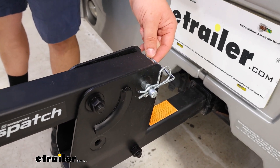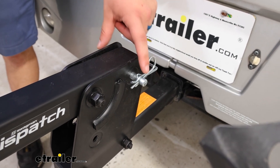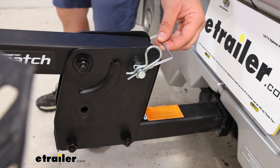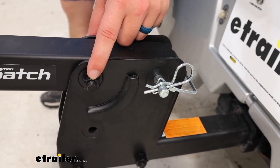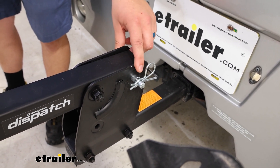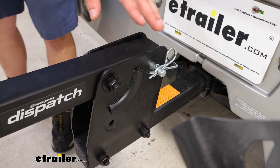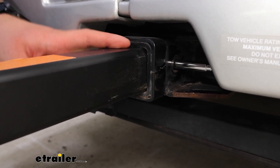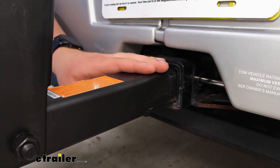This rack does have the ability to remove this pin and clip and fold it upright for storage. But when used on a motorhome, Swagman wants you to replace this pin and clip with an included nut and bolt — this is how it's going to come out of the box, so that's what it looks like so you know what to look for, and the replaced hardware would look much like this nut and bolt right here. Because of that, you're likely not going to be folding it up and down very frequently on your motorhome since it's going to be a pain to break out tools every time, which is why this position with the mast down is going to be your storage position. Down at the bottom it's fitting inside a two inch by two inch receiver tube, and it comes included with a locking anti-rattle bolt that keeps things nice and solid in the hitch. The lock is keyed alike to those hooks up top.